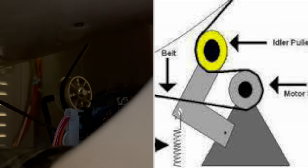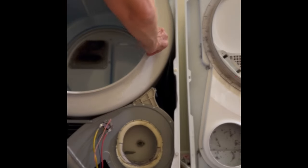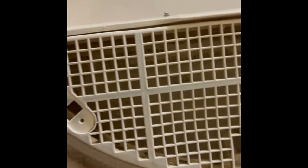I've got it now over the idler wheel, and I'm turning the tumbler back and forth to make sure the belt won't come off. I'm turning it counterclockwise and doing a couple of full revolutions. Now I'm reaching into the ducting and the door to clear out any lint that might be caught in there, because a whole lot of lint caught in there can cause overheating and shut it off too. I'm making sure the filter is nice and clear.